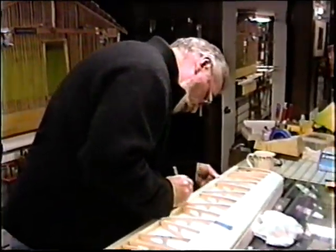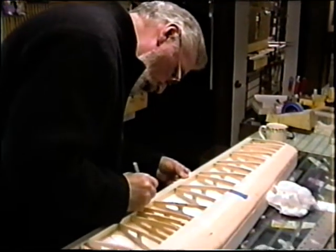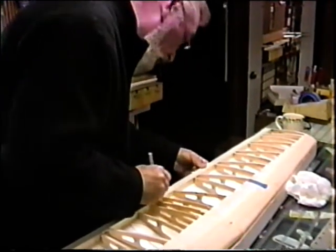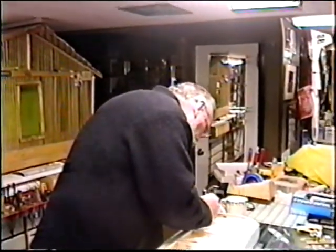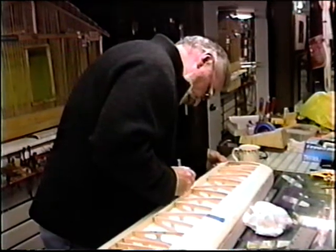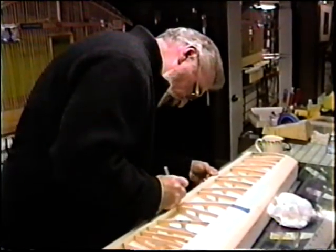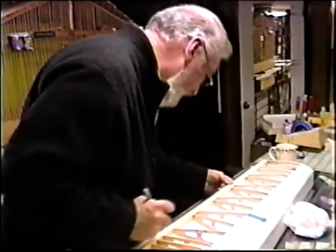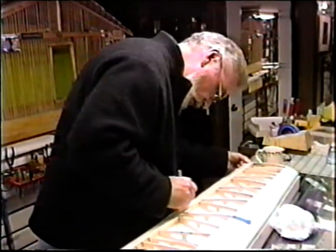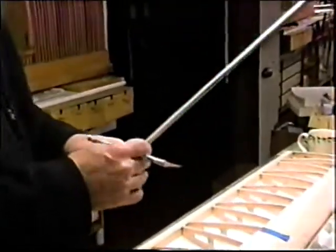Yeah. Well, when John Gajewski was cutting the mounts, he had that down to a science. See, it isn't the cut. No, it's what it is. The hardwood changes with the humidity. Not only with the humidity, it changes with the blade. John used to cut them. He'd buy the wood, then store it in a damp cellar, and then cut it. And then I'd take them and go store them in the attic, and they'd turn into pretzels. So I had a storm in the same humidity. So a lot of times when you ship somebody a motor mount and they put it on in a hot climate that's dry, they twist.